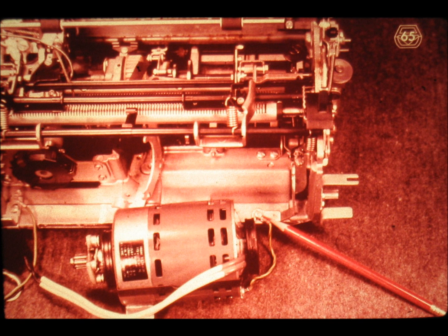On machines which have the on-off switch under the keyboard, it becomes necessary to separate the motor from the machine, leaving the switch behind. In that case, we disconnect the motor wires by either unscrewing the wire nuts or by disconnecting the wires from the switch directly at the switch.